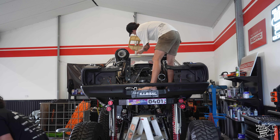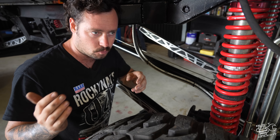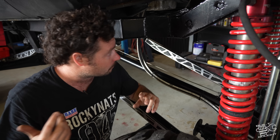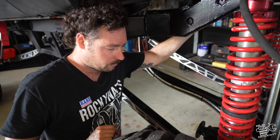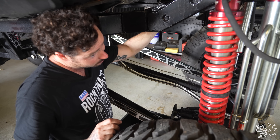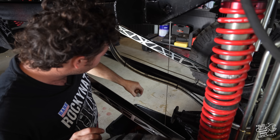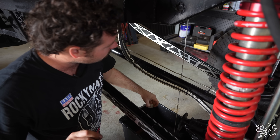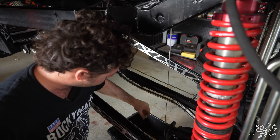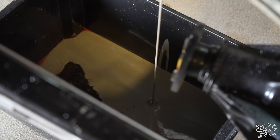This will tell us what the goal is with this manifold — it's sealing air because it's idling properly now, but the issue we're having is it was pushing water into the block. Over the weekend it was squirting water out of one of the bolt holes. I want to know whether it's still going into the sump. It's been sitting for about 24 hours, so I'll take this sump plug off. If water's settled in there, water will come out first, followed by oil, and it will definitely be milky. That's not too bad — the first time I did it was about five or six litres of pure water, but this isn't pure water, it's still oil. So I don't think it's too bad — we're getting close.